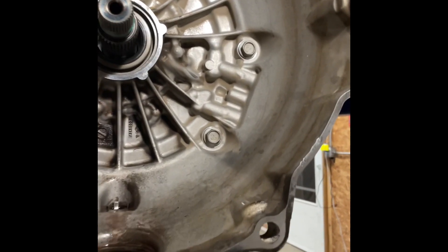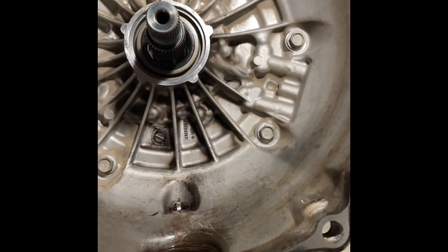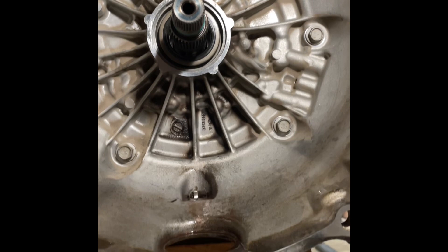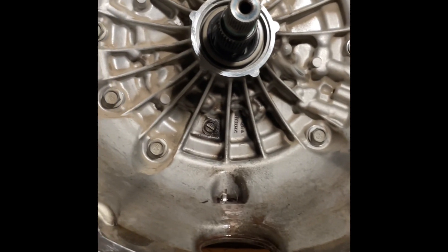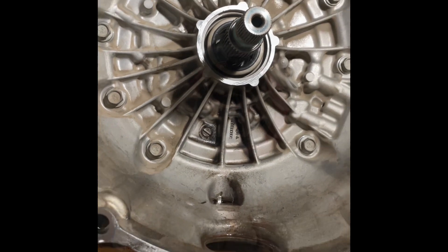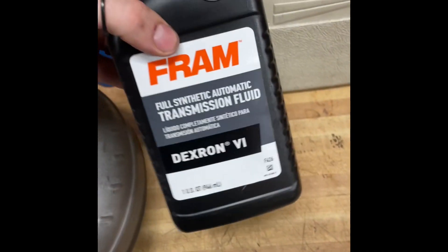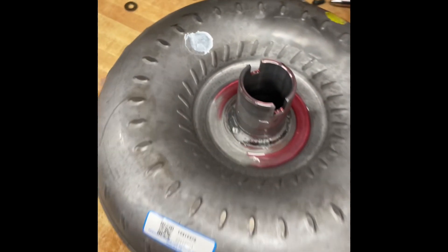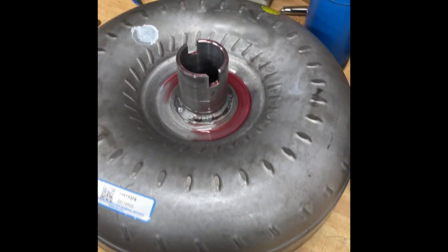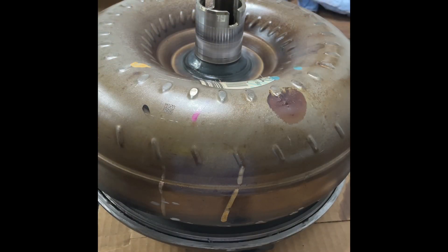Get the torque converter on three clicks - this shaft, that shaft, and then the two notches on the torque converter. When you push that in it drives your transmission pump, so you'll feel three clicks and then you're good to go. Bolt the transmission and torque converter up and throw it all back together. I pre-filled the converter with about a quart, so it should be good, but it'll pump up pretty quick once the transmission pump starts.